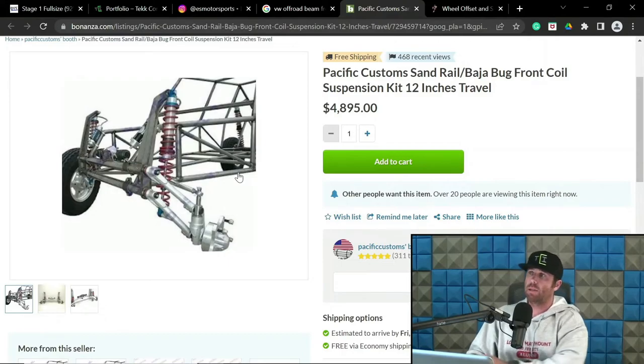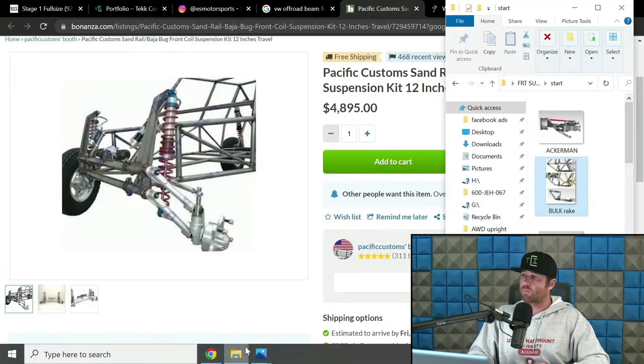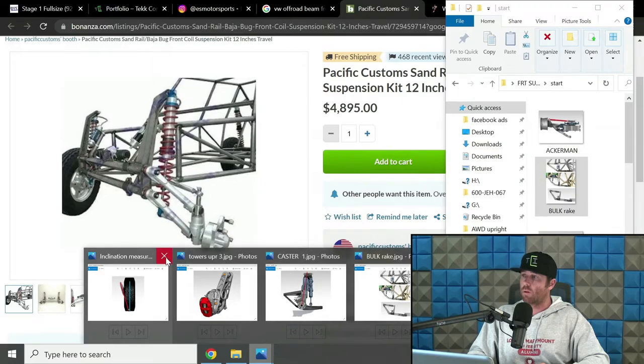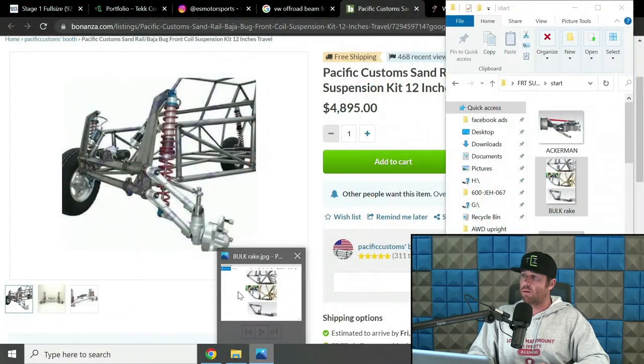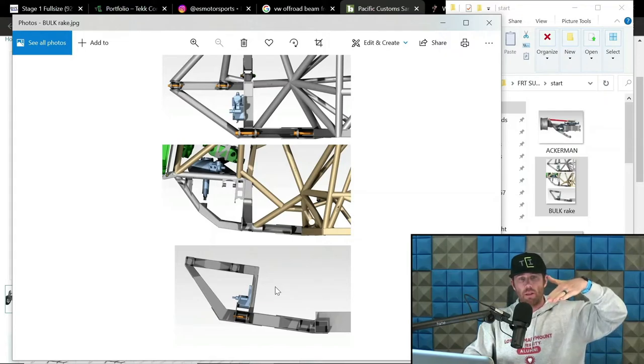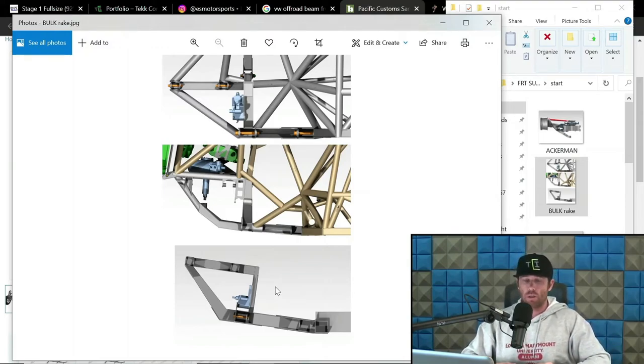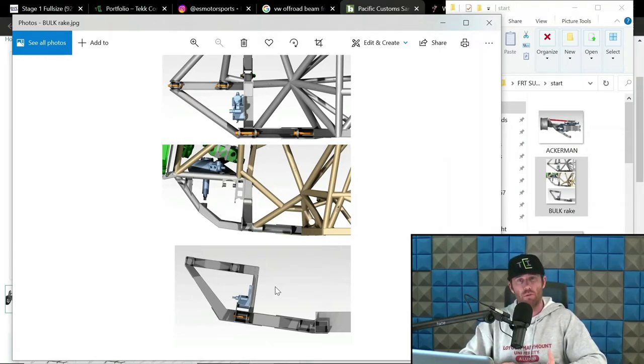And so the basic concept here is if you're coming into stuff with the race truck and you're going to hit a berm, a whoop, whatever you want to call it, or if the truck starts to come up a little bit, if it's going straight up and down, basically the tire is not mitigating any forces in an appropriate way other than straight into the chassis. So it's perceived to be rougher on chassis input relative to forces coming into the system, so to speak. And the system I'm referring to is the suspension.